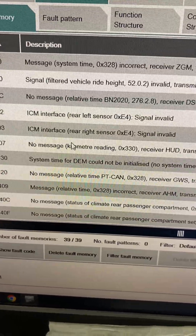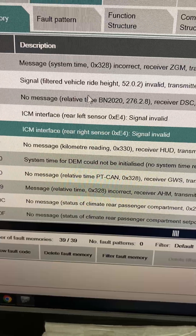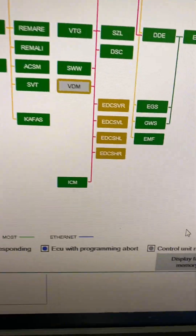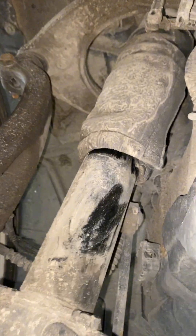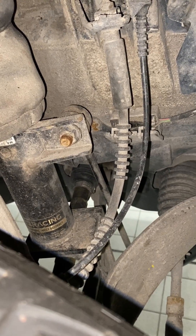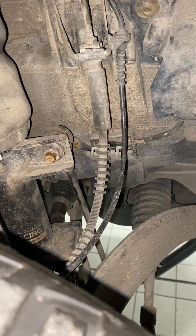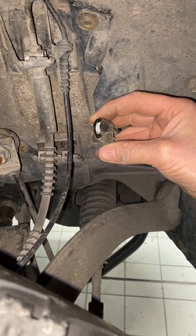FlexRay fault path six — rear left sensors not valid, so it's not measuring ride height. We've got no comms on vertical dynamic management. It's exactly as I said: it's got coil overs fitted. Looks like BC Racing ones — cheaper, and you can save money. But the issue is they've taped up some wires and left one exposed.